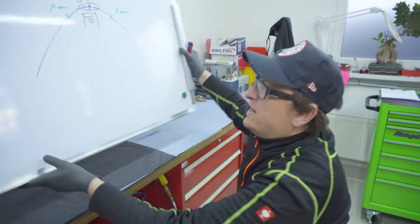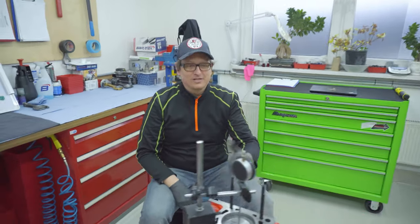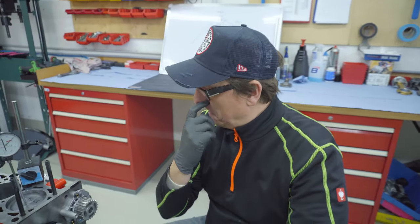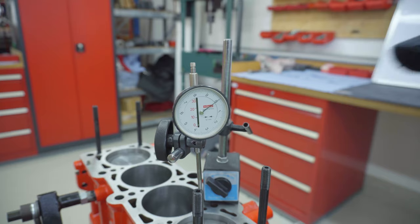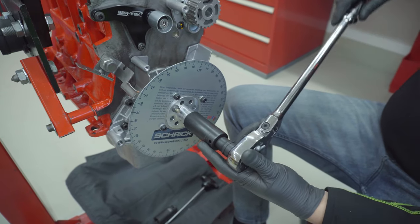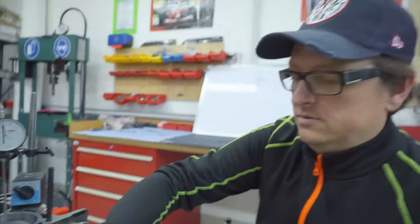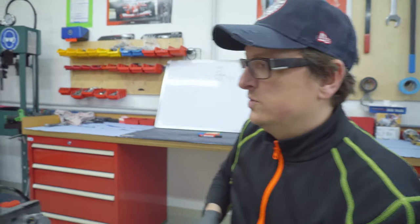We'll do this now today rather than on the dyno — we'll make it separately before that step. I put the magnetic gauge on top with the caliper gauge, and now I can turn the engine. It doesn't matter if you turn right or left at this stage. Normally it's forbidden to turn against the engine's turning direction, but that rule applies only if you already have the belt on. In this case, without the head installed, you can turn in either direction and it will not change the reading.